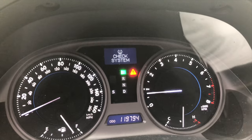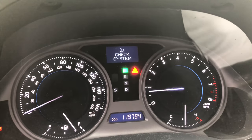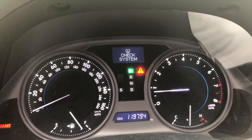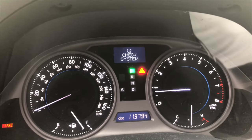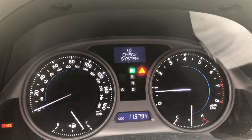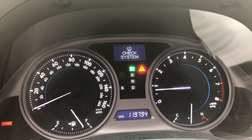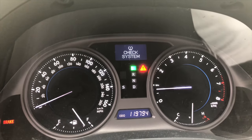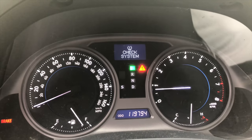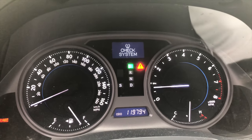Anyway, I hope that helps you to at least reinitialize for whatever reason. Typically you just drive this car and it will automatically reinitialize if all of the sensors are working. If you've got an '06 or '07, the batteries inside the wheels are probably gone. You can buy a set of them on eBay — I'll leave you a link on Amazon and eBay. Check that out, subscribe, and if you have a comment or a better idea that works, share it with the rest of the community.